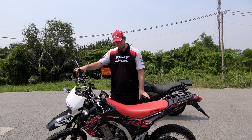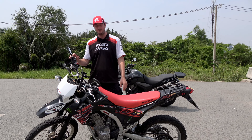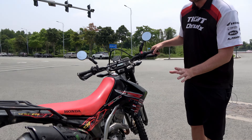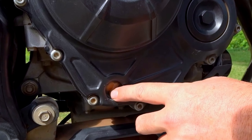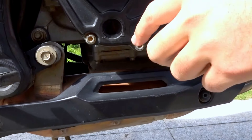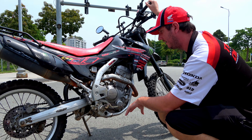Your next daily check is your oil level. At Tigit we tell you not to change the oil because we put in good oil — but that doesn't mean you shouldn't be checking it. If oil is burning out the exhaust or there's an oil leak, you need to know about it. Here's how: I have a full video on this, but a quick rundown — the oil sight glass window is always on the brake side. Have the bike completely flat; the window should be half to three-quarters full. If you rock the bike left and right you massively affect the reading, so it must be level.